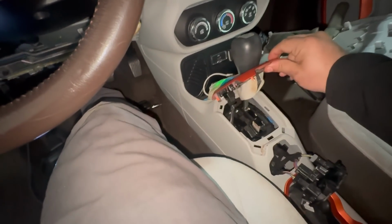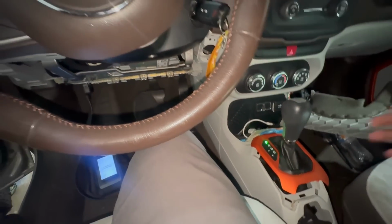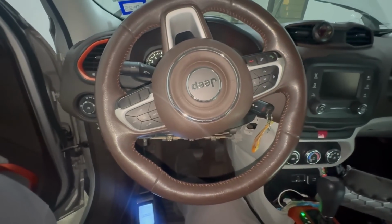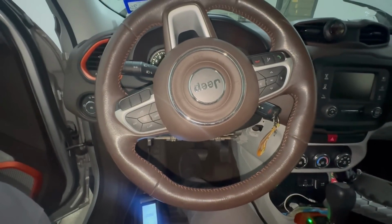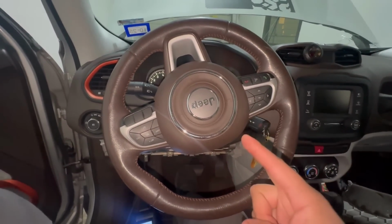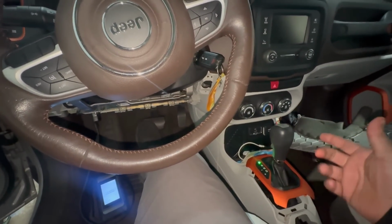And that's why he had this off. He had to put a screwdriver right there to manually shift it. Other than that, he couldn't move it. But he had all this stuff off too. So I finally said, okay, here you go, we're ready to go. And he told me, hold up a second. We still have a parasitic draw. And if you can kind of look at that. So what we need to do is fix up this parasitic draw, because if not, he's going to keep on having the same issues if they try to jump start it where it loses connectivity.